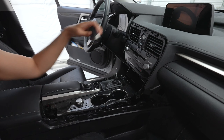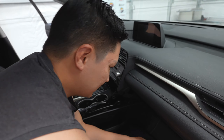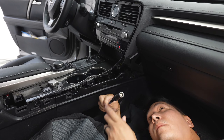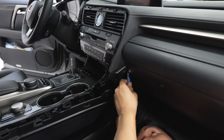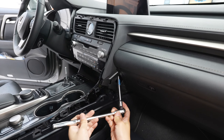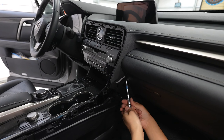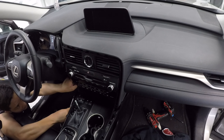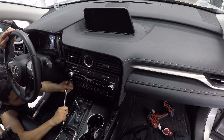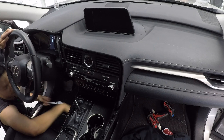Let's counterclockwise turn and remove this shift knob. Once that's out, we're going to remove the two 10mm bolts in here. I like to use the wrench for this just because I have more control — you can easily drop bolts, so be a bit careful. Then up here there's a 10mm bolt — just one. Loosen it with the wrench and then hand-remove. If you don't have a magnetic tool, you could wrap it with blue tape inside to grip it better. Let's get to the other side — that's the only bolt we're going to remove there.